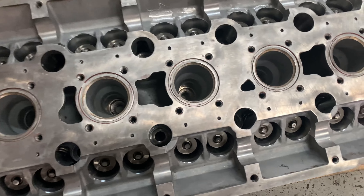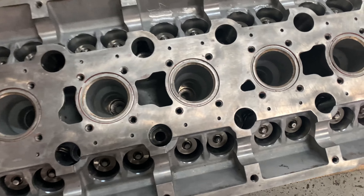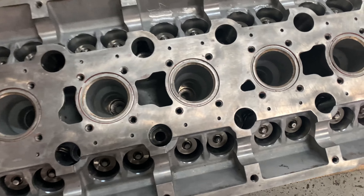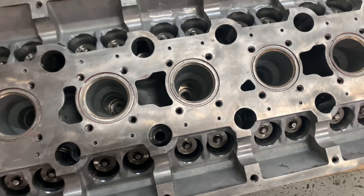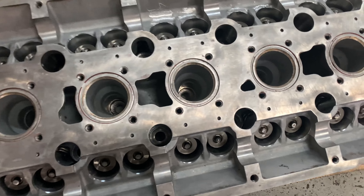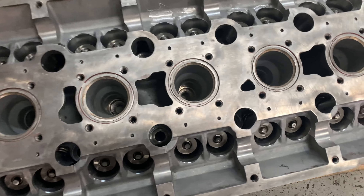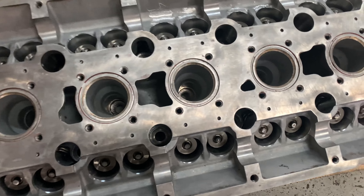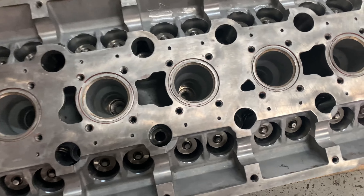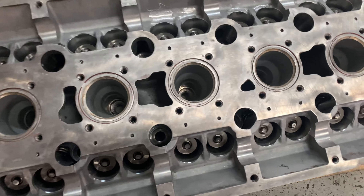We got the head on. We did 40 Newton meters, 60 Newton meters, and then two sets of 90 degrees. It wasn't easy but really wasn't that hard. I dipped the bolts in oil — literally dipped them — and there was no creaking, just smooth. I didn't hear anything crack or pop, so I don't think the epoxy inside cracked or any bolt holes cracked. Everything went really smooth. Fingers crossed this works out. We got new sealant for the top and I bought the official Volvo tool to clamp down the cover — I think using the bolts to clamp it down ends up stripping a lot of the holes.